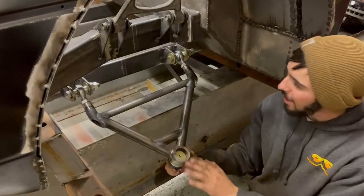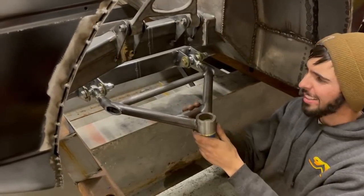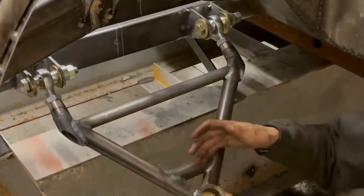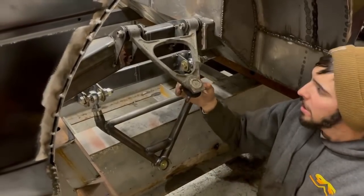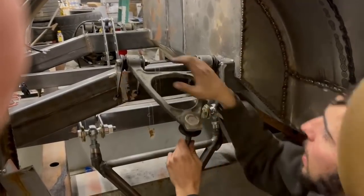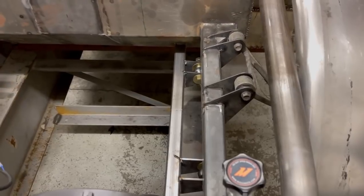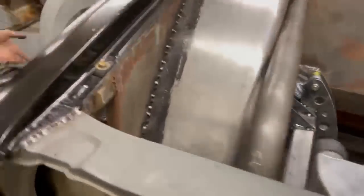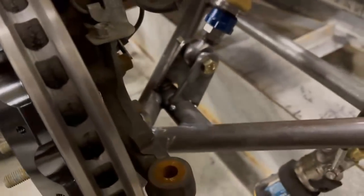Here's the bottom A-arm all fabricated and done. It ties to the frame rails and you can see the ball joint here — the cup is on a slight angle to go into the Miata upright correctly. The bar going across is what the shocks will eventually tie to, going up to mount here. Up top I decided to use the stock Miata upper A-arm for simplicity, and you can see the anti-dive angle is copied right off the Miata subframe. Coming around to the front, the front of the lower A-arm is actually out further than the rear to keep the geometry the same as the original Miata. Over here you can see the whole hub and upright bolted back together, the shock in place, the tabs welded to that bar, and the bracketry that mounts the shock and ties the upper and lower frame rails together.